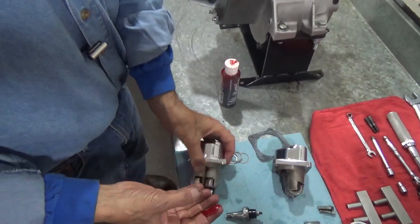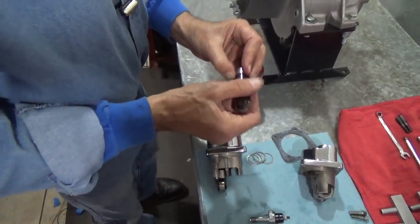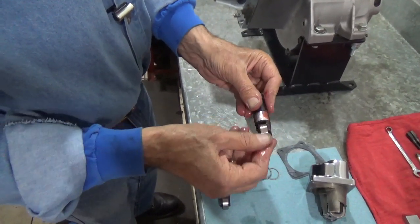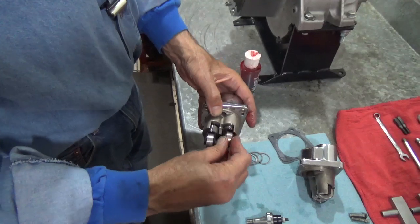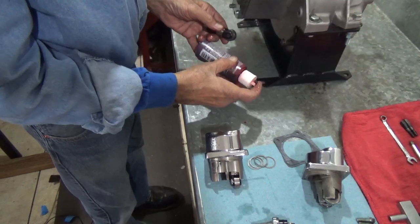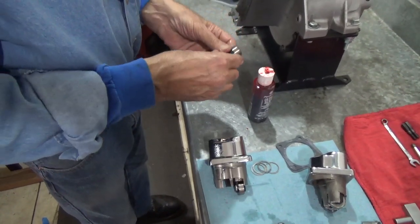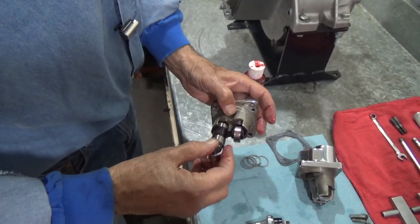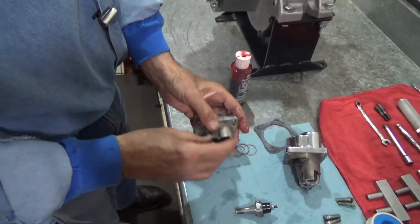This is the front, this is the rear. I've already checked all this stuff. So I'm going to put some assembly lube on everything — what I'm talking about is the outer surface of the lifter, and then on the roller I want assembly lube because it's going to be rubbing on the cam. Now we've got the roller done and the surface here, and there they are in place.